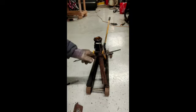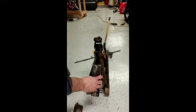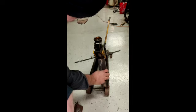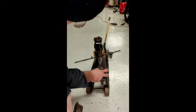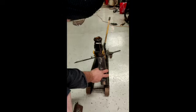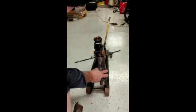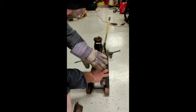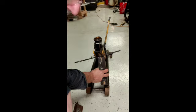Another thing to consider is the angle at which the cross piece gets welded. If I take this piece and line it up along one side of the spring, I can see there's quite a gap on the other side — probably roughly about a quarter of an inch. So I need to cut each end with that angle so that when I put the tool in place, it goes in at the correct angle between the spirals of the coils on the spring.